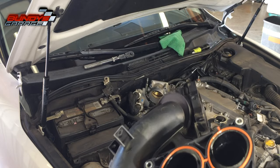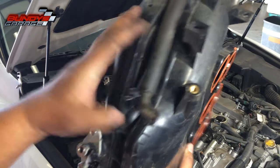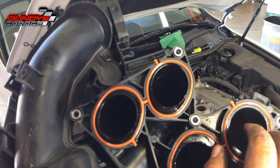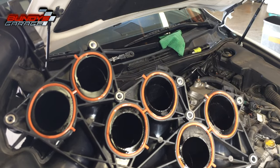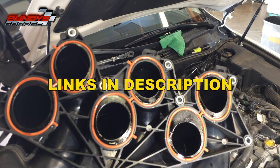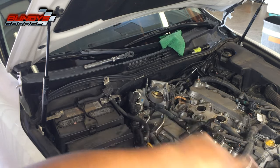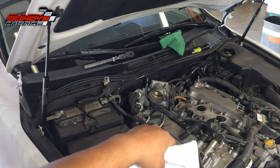Just had to squeeze the clip the right way. Here's the hose — held in by finger-tight clips. You also have these o-rings, and it's always a good idea to replace these when you do the spark plugs because they collapse and wear out over time. I got new gaskets from Fel-Pro — links in the description below. I'm going to put some paper towels down in the holes since they go straight down into the cylinder, then spray the top of the valve cover off so no debris falls in when I remove the coils and spark plugs.